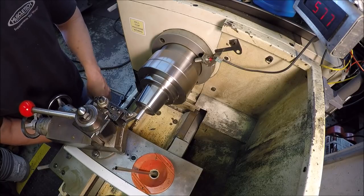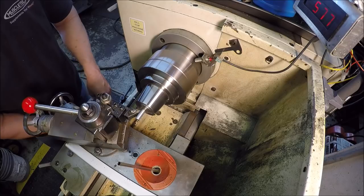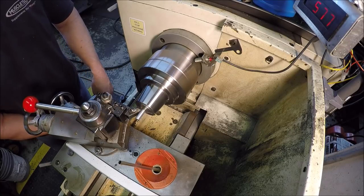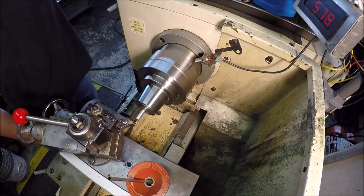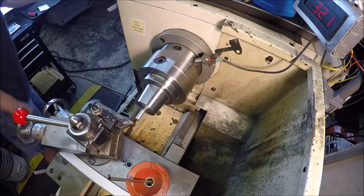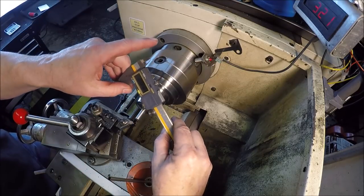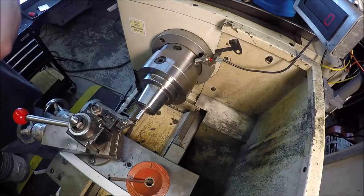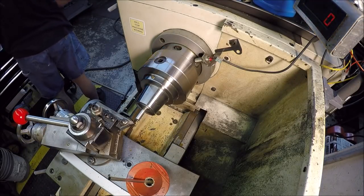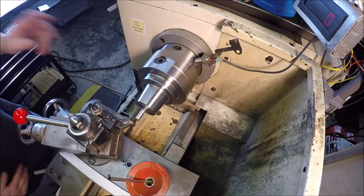I didn't think there'd be any machining on this Bronco repair, but go figure, right? Eh, a little bit hot. I'm just going to use the calipers here. Don't need a mic for this. 384, if you guys can see that. 384. So that gives me 9 to take off, so about 4.5. We'll just go in 5, no big deal on this.